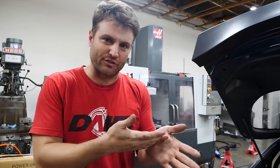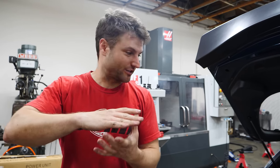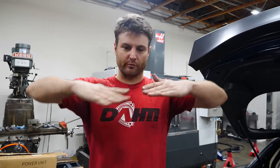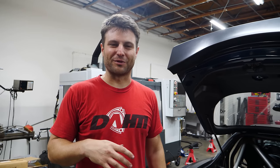If you look at those videos, you can tell that the car's squatting hard, which it's supposed to, but I'm afraid of it rubbing the wheels. Well, the good news is that we actually checked the height of the lower control arms and the car was sitting low, so we're bringing up the car. Naturally, we need more space, so it's perfect. So we're bringing it up a little bit, so the lower control arms are flat, and that means we have more cushion for the pushing.